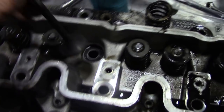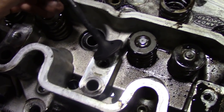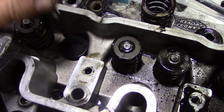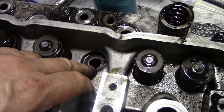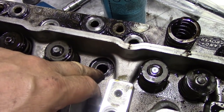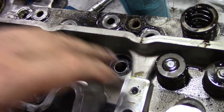This is probably the reason why it's got no compression. You can see how burnt the valve seat is — that's because it's been chattering backwards and forwards and not sealing right. What's been happening is the compression gas has been escaping up here, and on the induction stroke it's been sucking oil in like crazy because the oil has been sitting in this little hollow and it's just pulling it in.